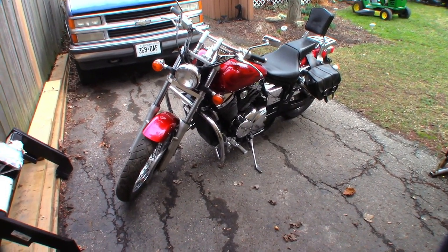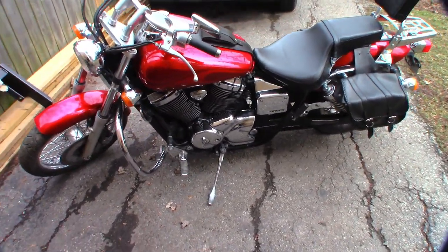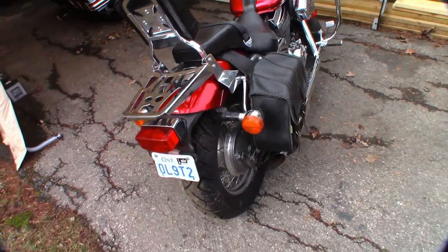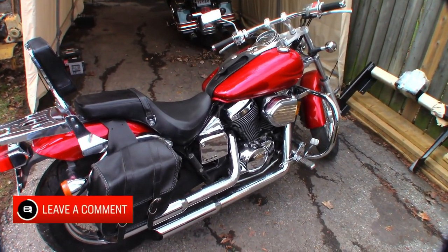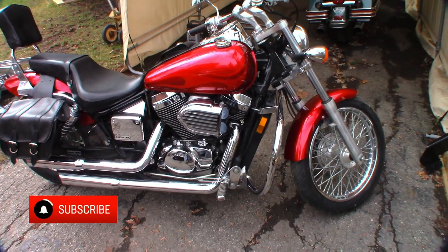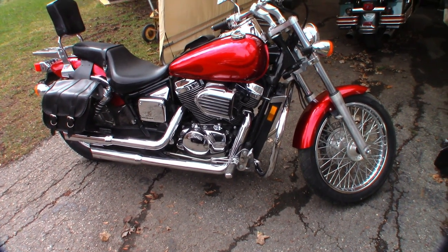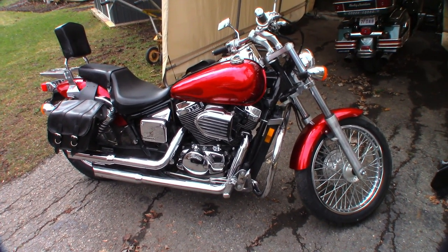There we go guys — she's all back together and running on her own gas tank now. It's a 2003 Honda Shadow Spirit 750. It's been sitting for a couple of years so it needed a little check-over. We set the valves — checked the valve lash and they were good. Repaired the vacuum piston diaphragm in one carburetor. Synchronized the carburetors. Oil change, tire pressures, lights — all good. Also flushed the brake fluid while it was on the rack — it's nice and fresh and clean now. Time to take it out for a road test and see what shakes out. Thanks for joining me — please click like, comment, and subscribe. Until the next one, take care.